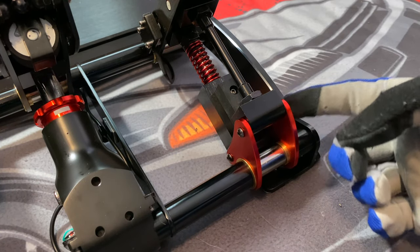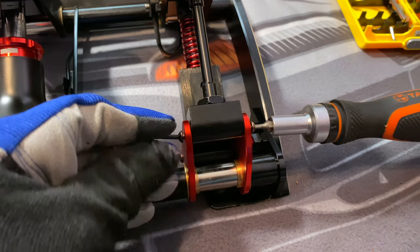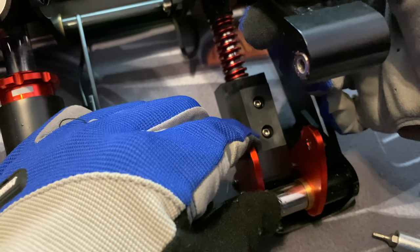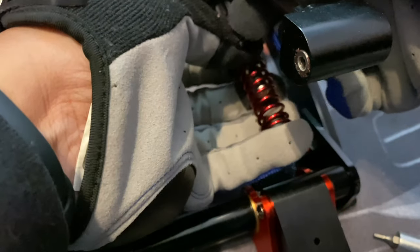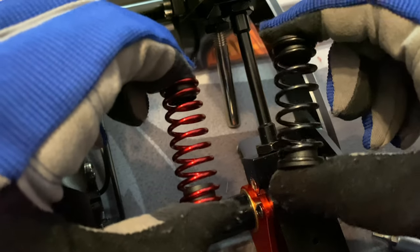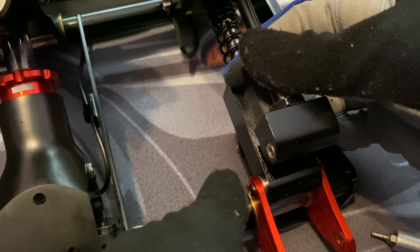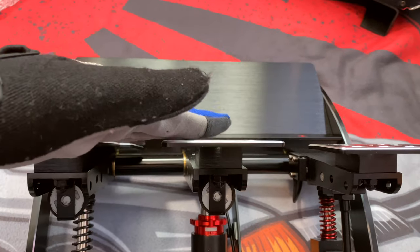The clutch is very difficult because of these two bolts — I twisted forever and it keeps going. You have to use two tools: go twist in the opposite direction and it should come out. Watch out for the thread lock — it makes it tougher. Once you take it out, push down, but be careful — sounds like a mouse trap! Take out the red springs, don't forget the bushings. Here's a comparison of the black and red. Put the spring back in reverse order with the bushings. Push the two bars upwards — it makes a big noise like a mouse trap.